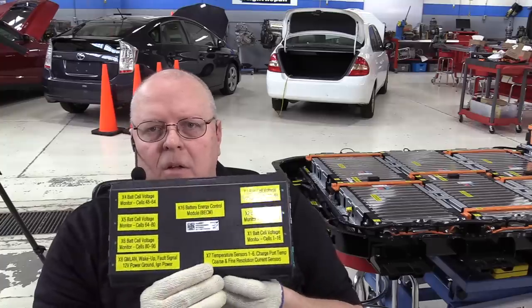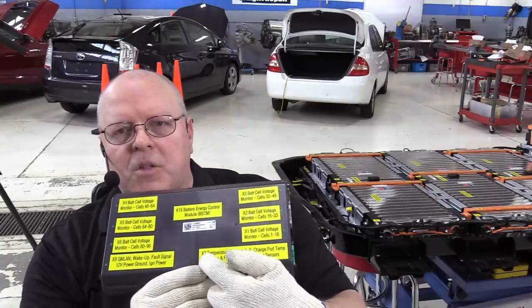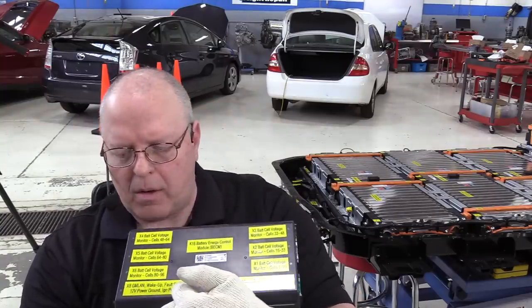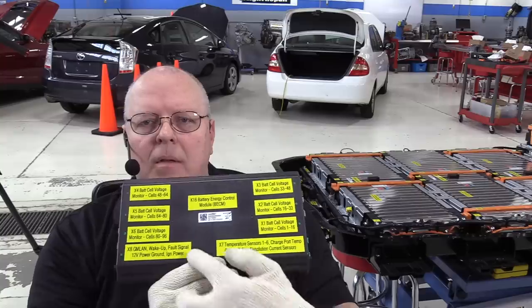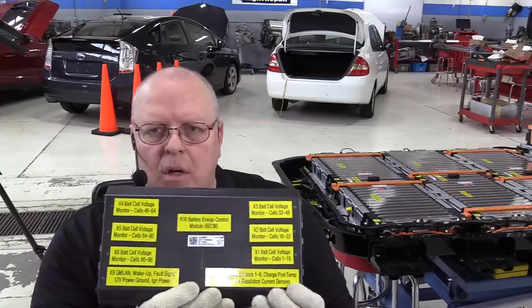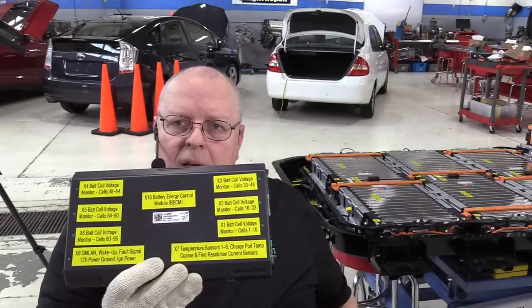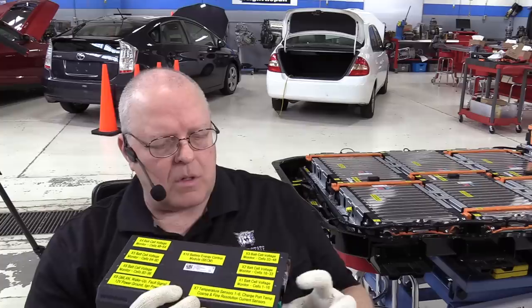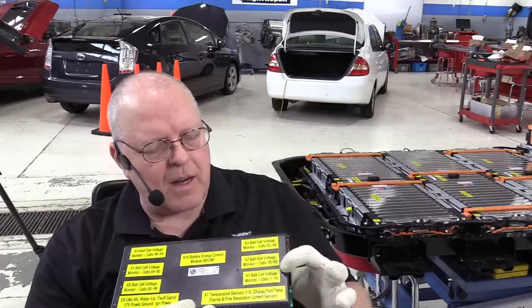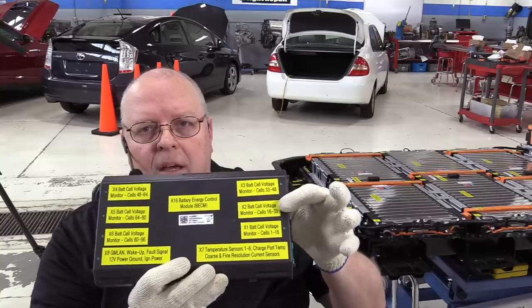And if you look closely here at each connector, we have connector number 7 and connector number 8. These two bottom connectors on each side are the low voltage harness connectors. And then the rest of these are the voltage sensing lines for the left side of the battery and the right side of the battery. So you can see the X1 connector right here is for cells 1 through 16. And the X2 would be